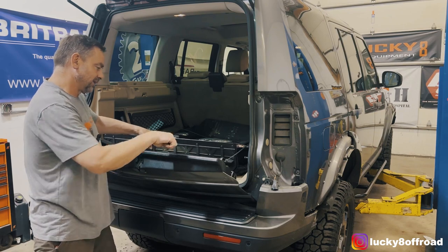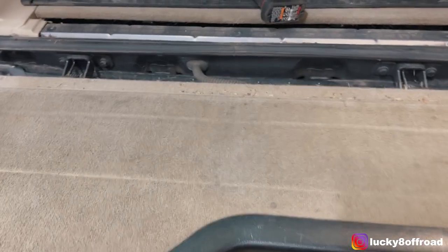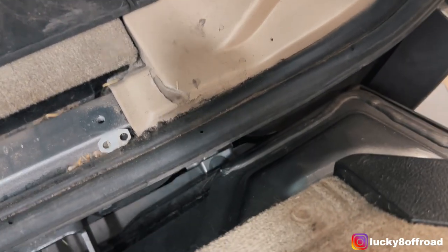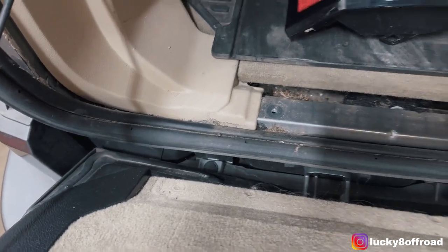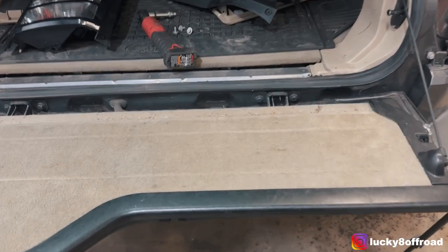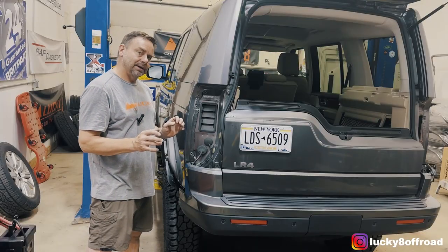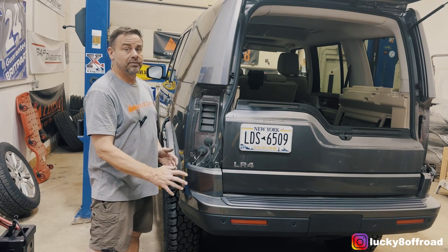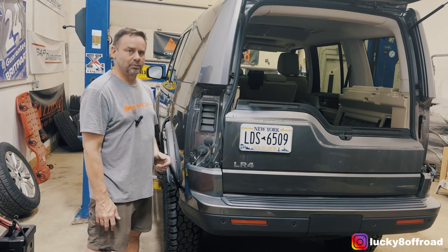If you've got a friend that can kind of balance everything while you get in there, you're going to be doing better than me — I don't have any friends. With the tailgate fully down, you can kind of see two of them. If you move it up, you get full exposure. And then there's two more way at the end — one there and one there. They're a little bit difficult to get to, but some patience and a bumper tool, you'll have it off in a jiffy. We are about ready to pull the bumper cover off. All I need to do is deal with these wiring harnesses. I'm going to gently move the bumper cover back, disconnect the harnesses, pull the cover off and set it on my bumper stand.